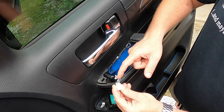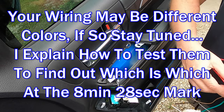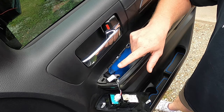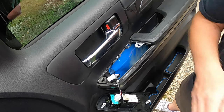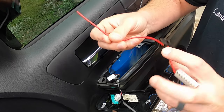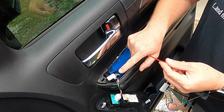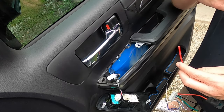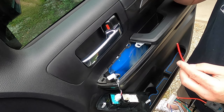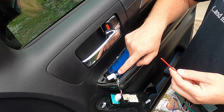You're going to cut those three wires — the black, pink, and green. On this wiring harness, the black wire on the truck is your constant 12 volts, your constant power. So you're going to take the red wire from the auto lock harness — it has a 15 amp fuse in it right here in this black holder — and connect it to the black wire on the truck. You can use weatherproof butt connectors, T taps, solder, however you want to do it.